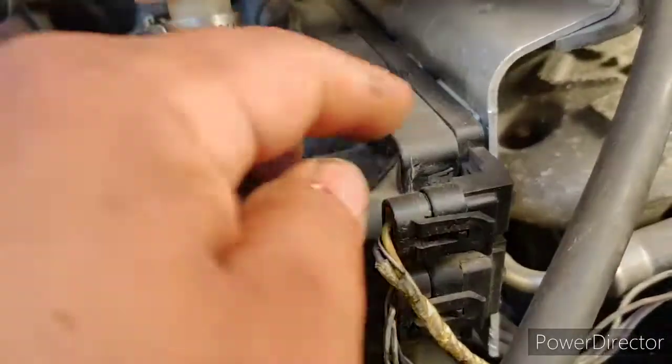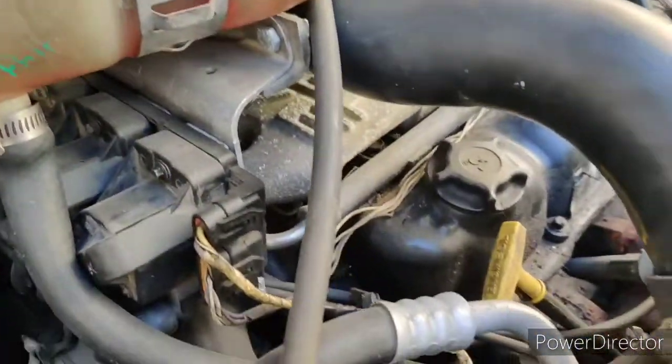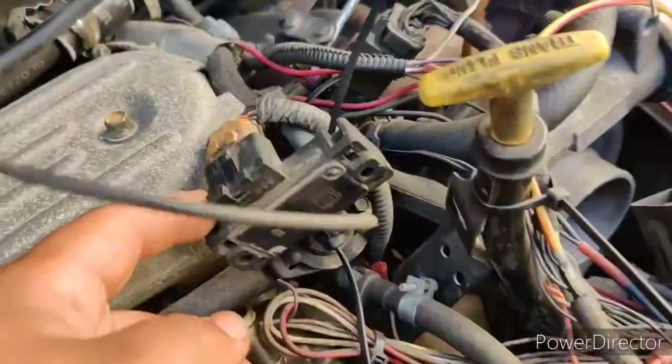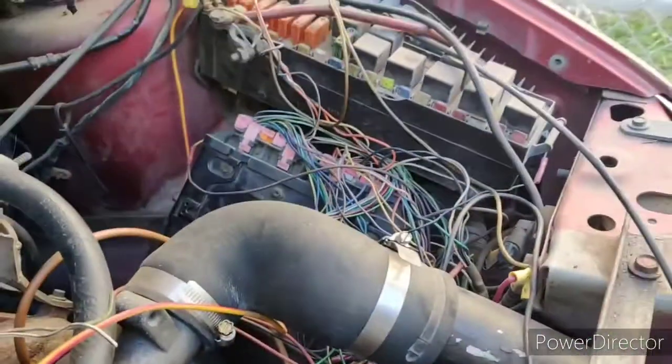I want to say that's the last time they used this style V6 coil pack. I made a bracket for it based off the alternator bracket. I'm using a GM 2-bar MAP sensor, but like I said I'll probably switch to a 3-bar just for the tunability.